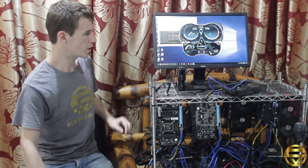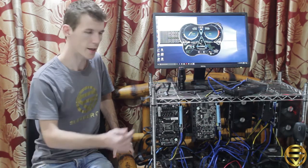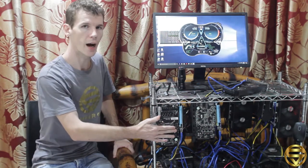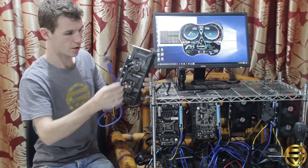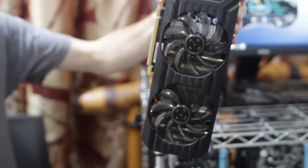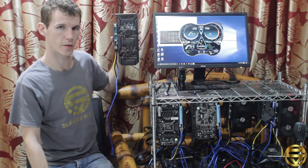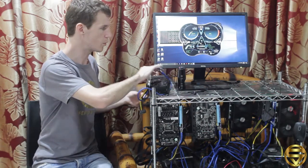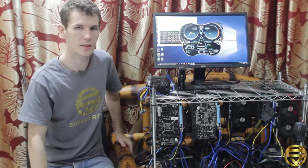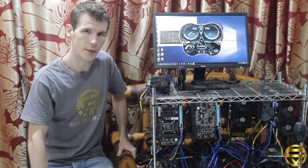Another feature that you want to take into account is once you have your machine running, a lot of people get their machines running and they're mining, but they don't really know that they need to regulate their fan speeds. So this machine gets very hot. It's very, very hot. So each of these cards usually have 2 fans on them. Okay, and these fans are actually controllable, and you need to regulate these fans. So there's various different ways to regulate your fans depending on your climate and the temperature of where you have your machine. It would depend on how you run your fans. Right now on this setup, I just have my fans running at 70% speed all the time, and that keeps my machine at an acceptable temperature.